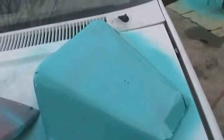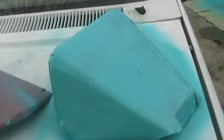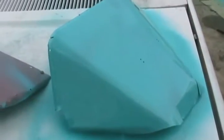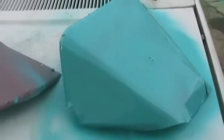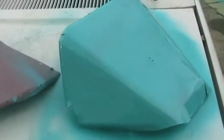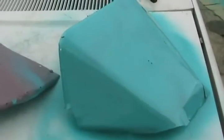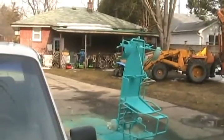Remember boys and girls, your first coat is the most critical. You put it on thin. Then when it gets sticky, the next coat you put on doesn't want to run and drip and make sags and stuff. The first coat is so important — don't try to make it look beautiful. It's still a transparent coat. You just want a nice even texture because it sets the base for painting your whole vehicle so that your texture comes out good at the end and gives you a nice sticky surface that doesn't cause drips later on.